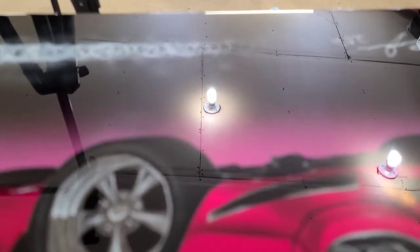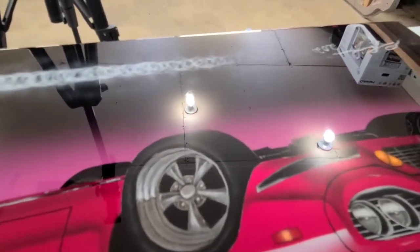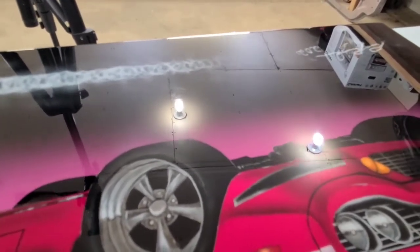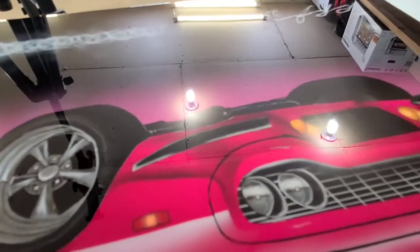See if I can get it to show down here. If you take a look at that light now, you can catch the scratches. There's just a little bit of 2000 grit scratches — you can kind of see them following that light. There are just a couple of scratches left from the 2000 grit wet sand. That's what you're looking for. You just want to get rid of most of those so your next step is pretty easy — it's just taking away a minimum. You can see this is the first pass with the polisher now after the wet sand.